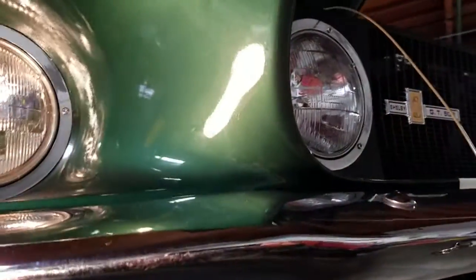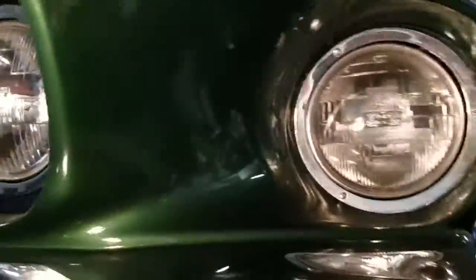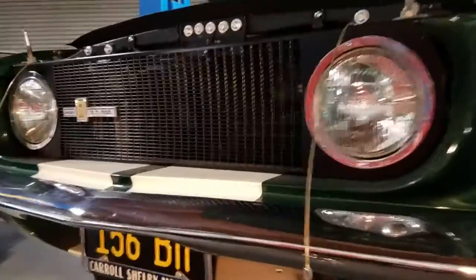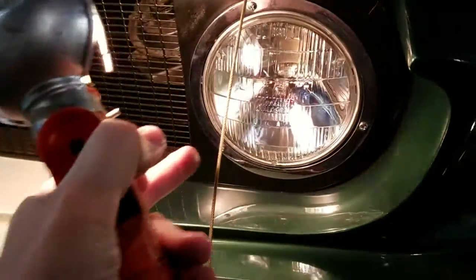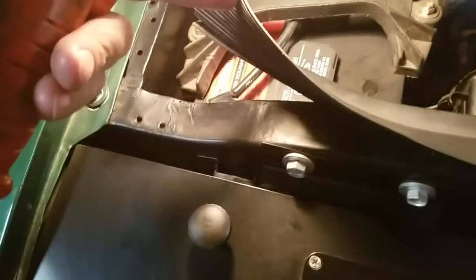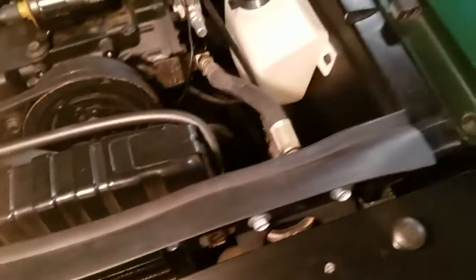This fiberglass header panel is a little smoother on the inside than the last one I looked at — there were three different manufacturers of those. These lights are not currently hooked up or operating. I believe this is a replacement grille setup. We pulled one of the blanks to get in there and access pictures of the tranny cooler, which is supposed to be ahead of the core support — and it is in fact in the right place. But the core support trim panel that attaches the grille is a replacement one. I don't see any indication that it's been changed otherwise.